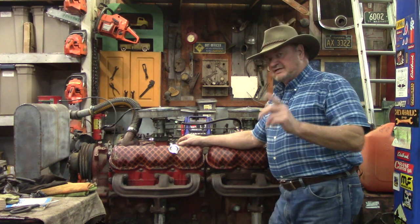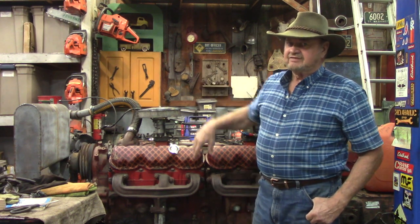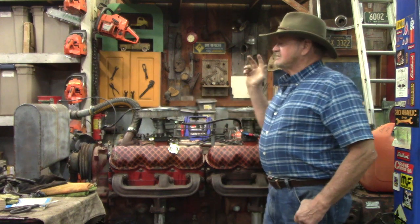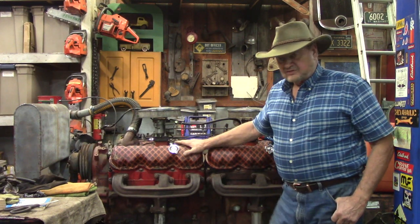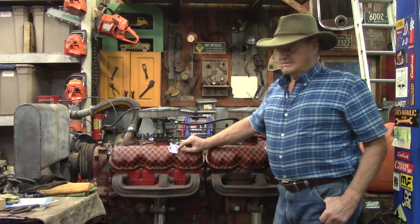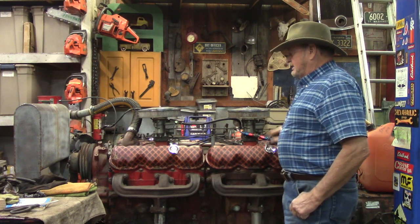Okay, so I got my PCV valves, 4 brand new ones, $5 a piece from Bob over there at Thunder 12. And I'll get to that in a minute, but that's what I'm going to do, is put those new ones in, and I can take the 2 that I borrowed out of a spare 305 V6 engine that I have, and the 2 that I took out of Jimmy Hoffa that I borrowed just to make this thing run, because I wanted to put water in it and bring it up to temperature, which I did. So now I can put those back in Jimmy, and I can put these in here, and then you plug off the valve covers, which I'm going to do with a little bit of bling bling, as you see here. And this one I've got to make a little bit tighter fit. But that's how I'm going to run it, as it was intended to run.